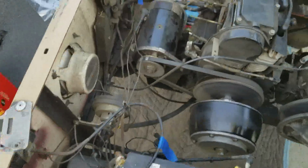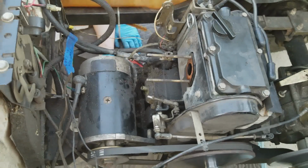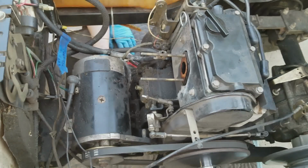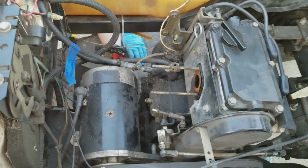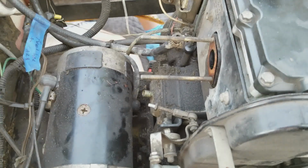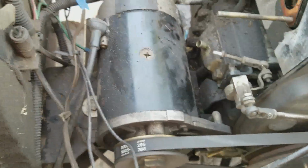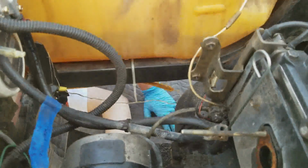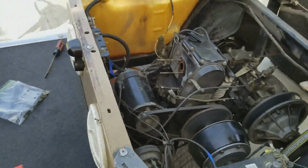Okay. So underneath the motor, there is a skid plate. It's got 4 bolts on it, 17 millimeter. Sorry, scratch that. 17 millimeter bolts on it, and my helper is going to take those off now because there are 8 engine mount bolts: 4 on the skid plate, 2 in the back. I'll show them to you later when I take them off. There are also 2 in the front, which I can't really see, but I'm going to have to remove the starter generator before I can see them well. So anyway, we're going to just remove those 4 from underneath.